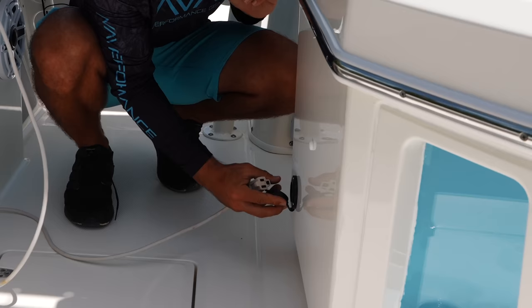I backed up as close as possible to the dock so I could just step right onto the boat, step on my spare tire, get down to the tongue, unhook our safety chain, and undo this right here. You've got to be careful because sometimes the boat may have some momentum built up as it wants to go down, so we're just going to release it nice and slow. We unhook, and this Ameritrail is what's called a power-on/power-off trailer. It's set up that way so it's as easy as possible to offload and load the boat. We're going to crank up, trim down a little bit, and if we hit that sweet spot we should be able to give this boat a little bit of throttle and it comes right off the trailer.